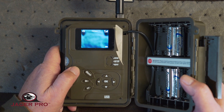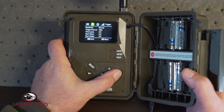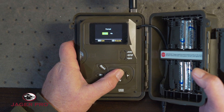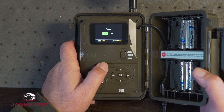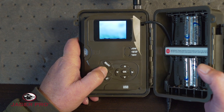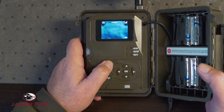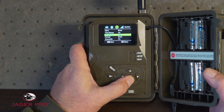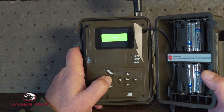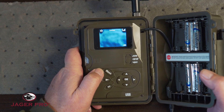To format manually, turn the camera on to setup. Press Menu. Press the right arrow two times to System. Press the down arrow four times to Format and press OK. Press the left arrow to Yes and press OK. Once it finishes, press the menu button twice to return to the live preview screen. Below the menu button is a playback button. Press and release this button — it should say No Image. If you see a recent photo, the format didn't work and you will need to format again, or use a different SD card. If it says No Image, the format was successful. Press and release the playback button again to return to the live preview screen.